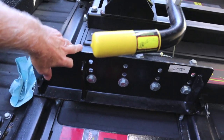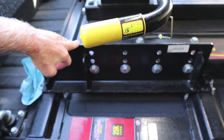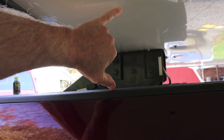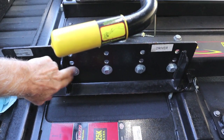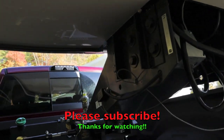But when I was making my adjustments, I called Demco and was talking to them about it on the height. You still need about at least 5 to 6 inches minimum here. I was happy to get it in its lowest position and still have everything to come out pretty level, because I did not want to have to raise the kingpin up anymore.